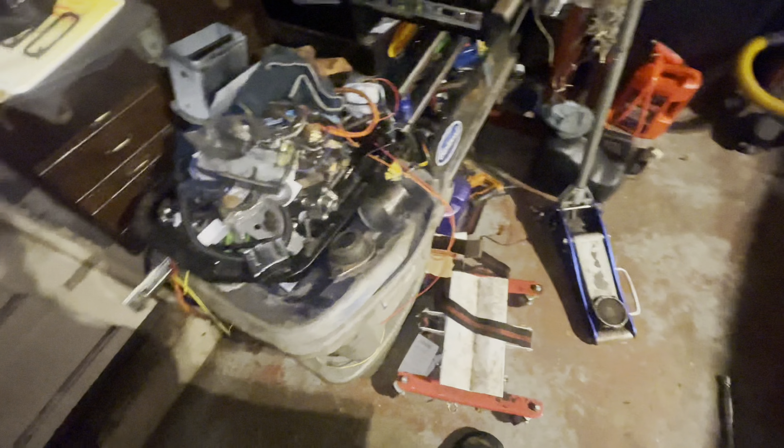That is in gear — this car should not move nearly that much in gear. Last time I had this car off the ground I was able to spin the pinion pretty much halfway around, just free slop. It should maybe spin an eighth of a turn at max, not halfway around. I believe what we're going to find wrong in this diff is either a ton of backlash on the gears or an issue with the pinion bearings, because the pinion does have play up and down.